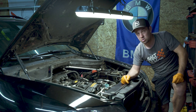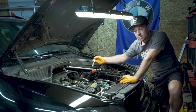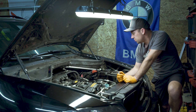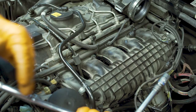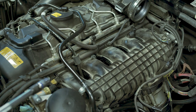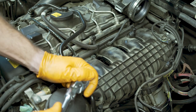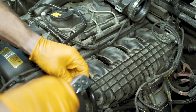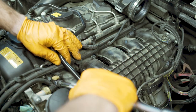At this point, we're just going to undo the remaining six nuts and the two bolts, and then we should be able to lift up the intake manifold and go along our way to unbolt the oil filter housing. You always want to go from the outside and work to the inside - start at the back, then the front, then work your way in with all these bolts and nuts. It's just the way the pressure is distributed, and that's the same thing on oil pans and exhaust manifolds. Also very important: make sure you don't manhandle or try to be rough with any of these vacuum lines - very gently work your way in.